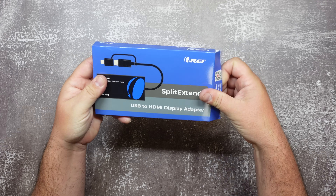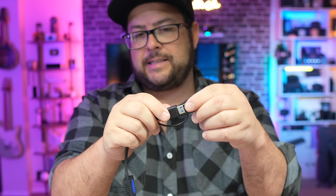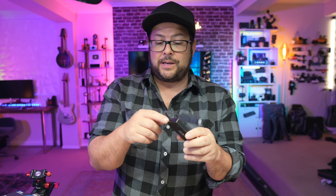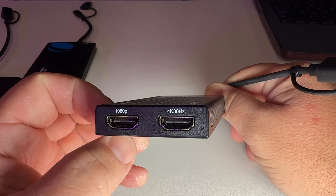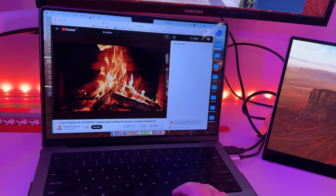The downgrade of that would be something like this. It does have a USB-A connection or you can attach it with USB-C. With this one you don't get a charging port, and you only get 1080p on one output and 4K 30Hz on the other. But maybe you have a standard HD external monitor and a 4K one — that would work great. You can have one at higher resolution and just put notes and stuff on the other. It's nice and could be very handy.